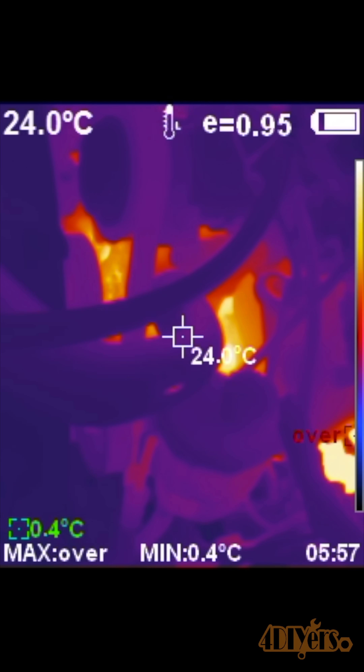Right now I have the camera set up to watch the hose coming off the thermostat housing. I have sped up the footage so you can easily see the engine warming up, but the hose after the thermostat still remains a cooler temperature. If you see the hose warming up with a similar temperature around the housing and are not noticing a drastic change when the engine comes up to full operating temperature, then most likely the thermostat is stuck open.